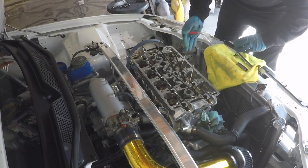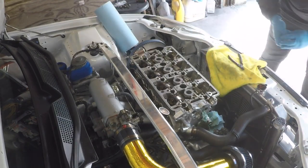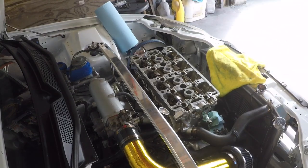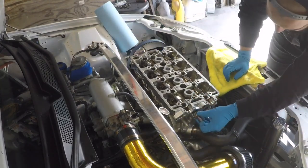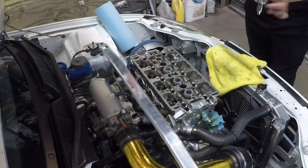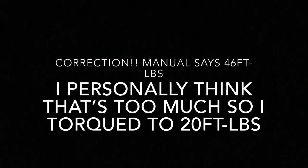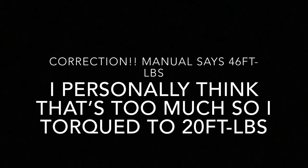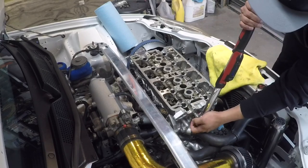So now I can cut these zip ties, put those caps back on, and then I can lay the cams in. Clean, let me grab those caps and the number 10 Allen key to thread those in. Handy dandy torque wrench. They are supposed to be torqued to 7.75 pounds or something like that. Give these a little tighten, a little more than what I did from the thing.